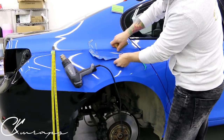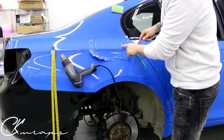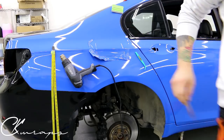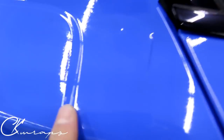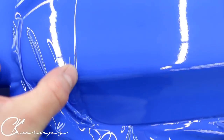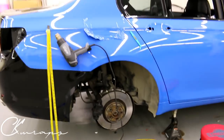Now that we have stretch around the corner, I'm going to show you what actually happens. You can see that the vinyl is pulling itself in around the corner. If we have too much slack here, you start to get fingering when you go to trim and roll it around. When I heat it and shrink it, it'll actually want to roll itself around on its own most of the way, which helps reduce the amount of slack left over.